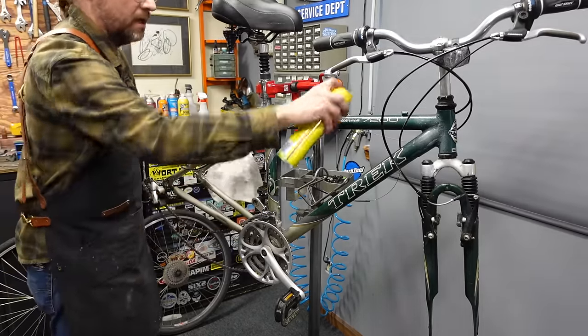I'm not okay with this stem angle — it's pointing straight up into the sky. I also don't like the kickstand length. Kickstands are pretty cheap so it's not the end of the world, but that bike's gonna fall over all the time. I was guessing while it was in the stand — there is a gauge on the side I could have been reading, but this kind of stuff is easier to do with the bike on the ground. I can see everything's straight, parallel, perpendicular, tight. Maybe that kickstand's not so bad — actually not bad at all. And I see a little bit of rust in the bolts on the brake levers, some dust back here. This bike was hung up from its rear wheel and stayed that way for a long time — that's what that tells me.